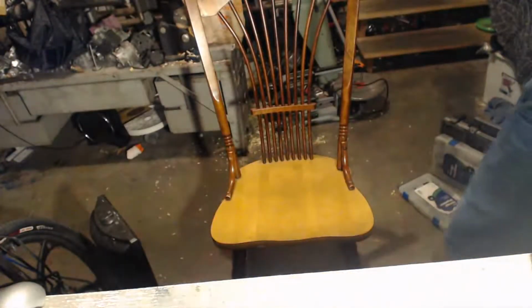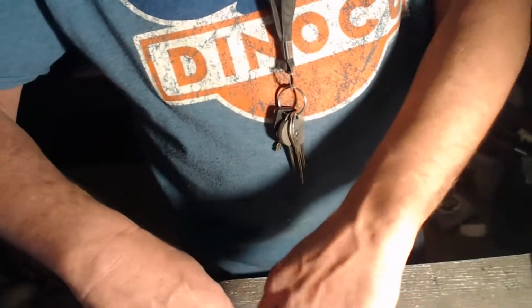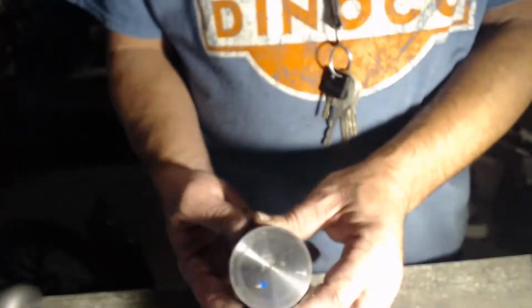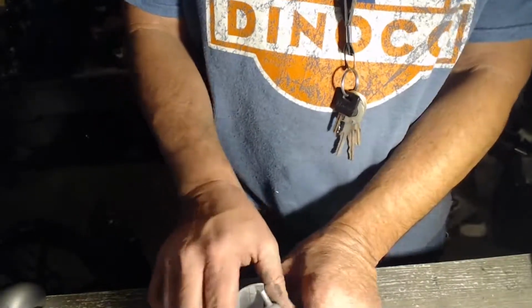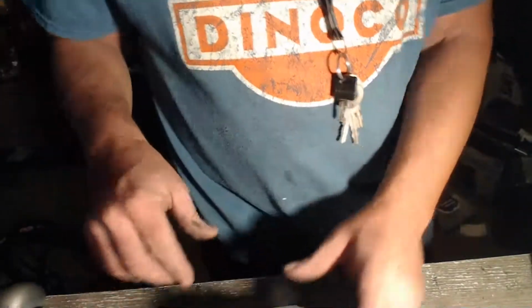I've been reading up on Grubby's CDI, and I've been learning a little bit about setting the timing that way. But yes, I'm very fascinated with the 288. The 290, the 395 is just probably going to be more amazing because it's a round cylinder with 4 transfers on each side. I could tell the piston isn't made exactly right for the cylinder, but you know, it's China, and that's why everybody buys a better cylinder and piston, is because they're mated together much better. But you know, who wants to waste the money until you figure out if it can be done first? Before you redesign it, you have to do it.